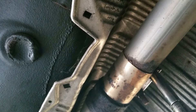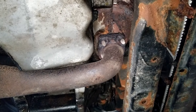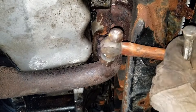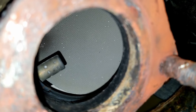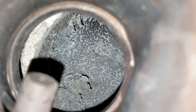So Mongo's going to undo the exhaust, bring the Y pipe down, and make sure both cats are even. Those bolts were tight — broke one, and it's got some holes in it. That one's seen better days. Now we just have to chisel away the remnants of the front nuts. Let's take a look at the front cat — maybe a slight clog, but it's pretty good. Mongo wouldn't be worried about that little kitty cat. Now the rear one — yeah, that's a clogged kitty. The rear one's all messed up looking.